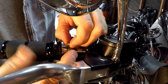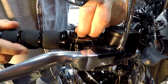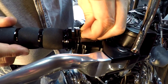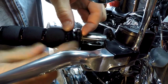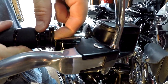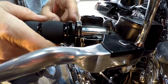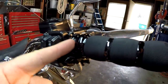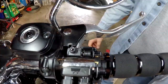Pull that cable up and hold it. There's a notch, so you're going to set that on there, then turn it all the way to the other side. Pull the lower housing down so you can get your throttle cable back in there — turn your throttle, stick that in there, roll it forward, and pull this up at the same time until it pops into place. You'll see it's in line; there's a little notch there that the cable rides in and that's where you want it to sit.